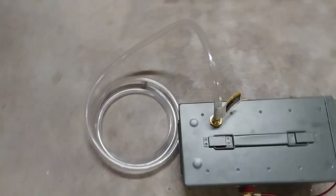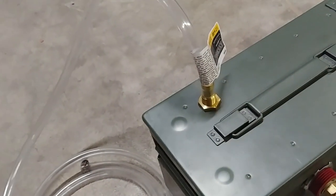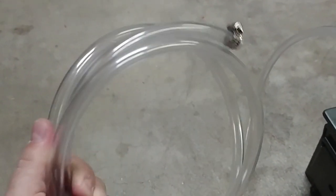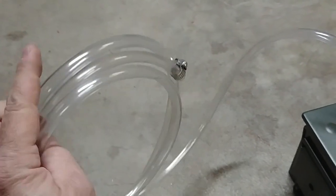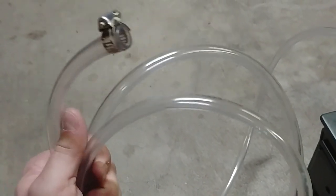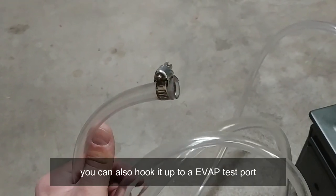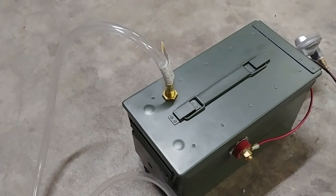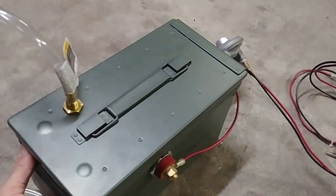Up here is another bulkhead fitting going to a hose barb — this is all from a hardware store, all stuff you can get in the plumbing section. Bulkhead fitting, barb fitting, some tubing — and the tubing is ultimately the line that you hook up to a vacuum port in your intake system to check for vacuum leaks. The tubing goes to a vacuum port, usually somewhere on the side of the intake manifold, on a carburetor or even a fuel-injected engine. You disconnect the vacuum line, hook this tubing onto it, and this device will push smoke into your intake and subsequently into your entire vacuum system.